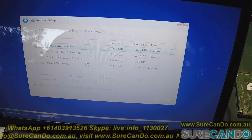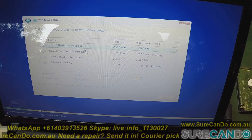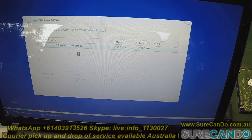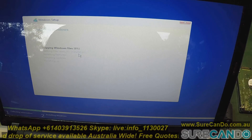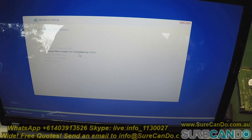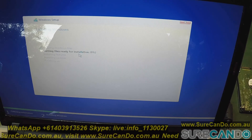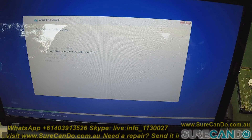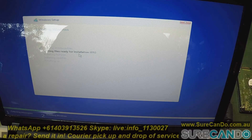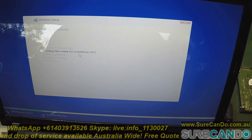The product key went in successfully and we can delete every other partition. So that's about it for installing Windows 10. There wasn't actually an issue with the controller - it's just Windows 10 version 2004. They removed some chipset drivers which means it does not recognise certain older machines. If you have this problem, go ahead and get the 1909 or earlier version of Windows 10. See you in the next one.